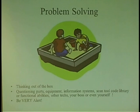I'll give you an example. I got burned twice. I'm using an aftermarket scan tool, and I'm not going to mention what it is. I've just been playing around with it. I'll give you three scenarios. How would you like to go to a shop and get a simple problem of a steering angle sensor fault, and the value is negative? The steering wheel is straight, and the value is negative, like negative 300. Then you cut the wheel, and there's no reaction.